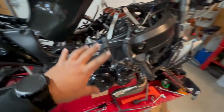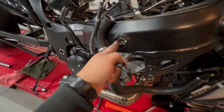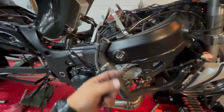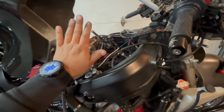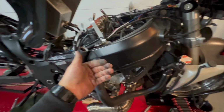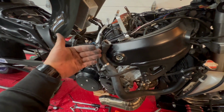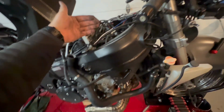Another update on the tools. So there was a slight thing. I didn't realize that there was another castle nut up here. Then you would need a 12mm Allen to loosen that sleeve, which again, sandwiches the motor. So the motor, for the most part, when it comes to sleeves like these to go against the block itself, the motor sits more that side, bolted directly to it. And then these sleeves on this side make up the difference. So just so you have that point of reference, any of the sleeves are all on the right side of the motorcycle, the direct bolts are on the left side.